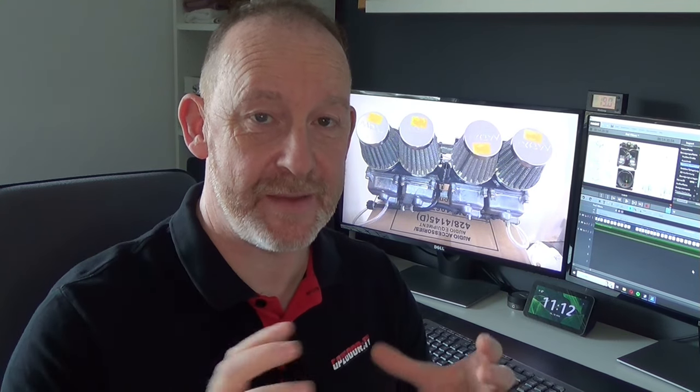That was just a quick video on where some of the problems lie on our GPZ 600s. The GPZ 600 is unfortunately particularly sensitive when it comes to airflow changes, as are a lot of bikes that happen to have Keihin carbs. The fact of the matter remains: the GPZ 600 is just too sensitive to airflow change, which means simply taking the air box off and putting pod filters on won't work. So unless you get a garage to do your rejetting professionally, you will spend a lot of time and effort trying to rejet your carbs yourself, and without a rolling road to check any of the actual power outputs it's all a lot of guesswork.